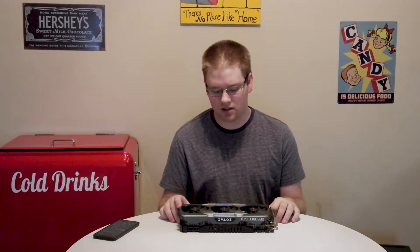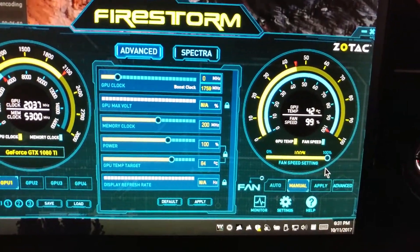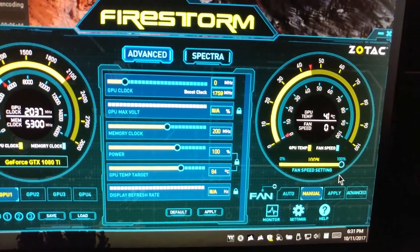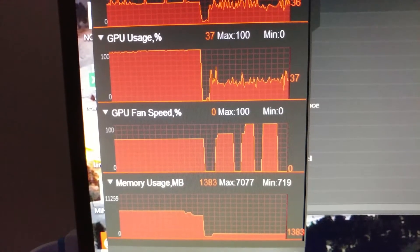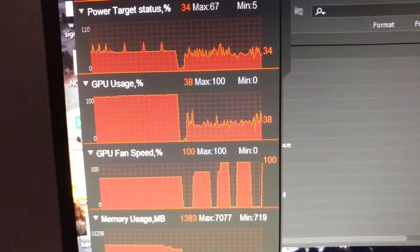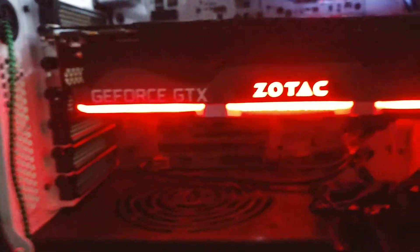In the past three days, I started to notice a big flaw with this card. Whenever I'm editing in Adobe Premiere while my wife is playing a game that's not too intense, such as The Sims, the fans on here will stay at 0%, and then every few seconds they'll ramp up to 100% for about 10 seconds and then go back down. The core on the graphics card is never going over 45 Celsius — the thing causing the fans to ramp up and down is the VRM.